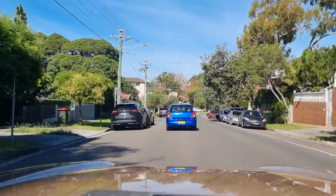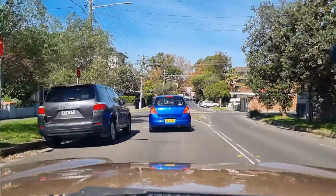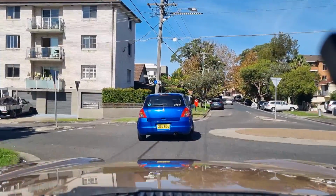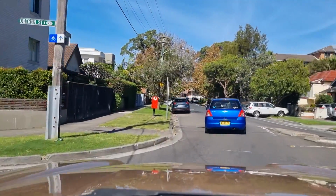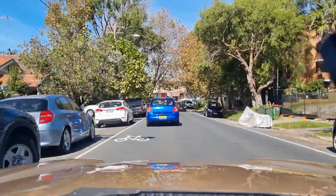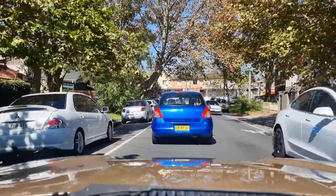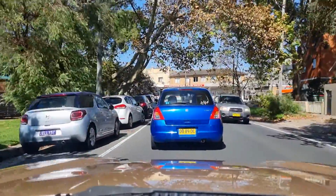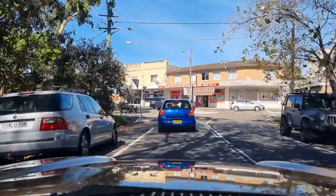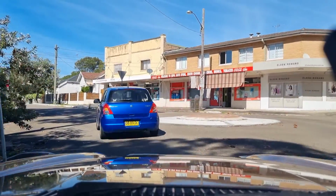A distinctive feature of the XJSs, they all had the flying buttresses at the back, except for the convertibles and the cabriolets. They did make a cabriolet form, they did make a convertible. Convertibles came out in 88, I think cabriolets came out in about 86. And in 86, the cabriolets also came out with a 6-cylinder engine first time, and it was the AJ6 engine in 3.6 form, which later was added to the XJ40s, which came out in 86 as well.